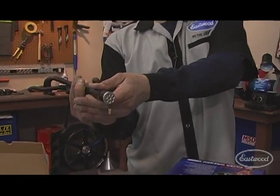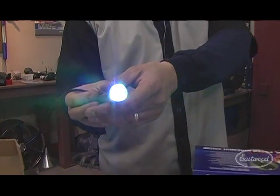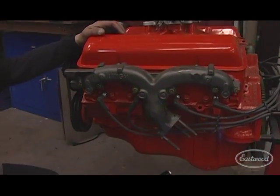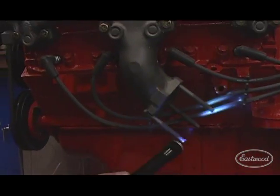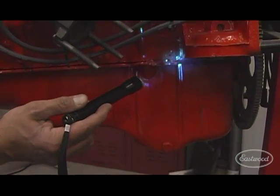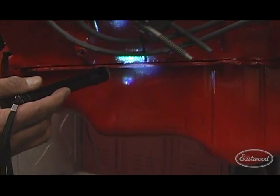This is the UV light, which allows you to see the fluorescing dye. If you come along — we know we've got a leak coming down from either the valve cover or the pan gasket — you just shine the light along where you see oil until you find the fluorescing dye. You'll notice the green-yellow color. And there we go — now we know our leak is right down here on the pan.